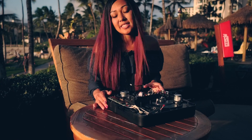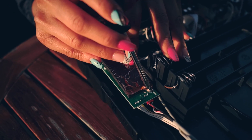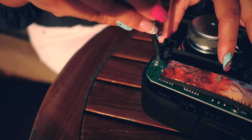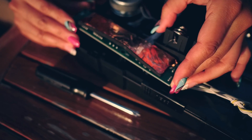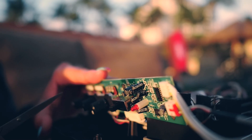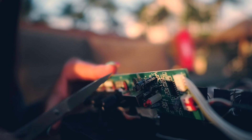Now that we have removed the bottom part of the portable, we are gonna need to access a certain piece underneath this section here to increase the cut time when you scratch. I'm gonna remove this screw, this screw right under that, and this screw. Remember that the screw in the middle has a washer — let me put the washer on it. Carefully lift this piece up. What we're gonna do is remove this one right here, which is labeled C513. It's almost directly above this red light, so it's right there. I'm gonna take these fine scissors.